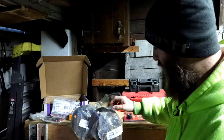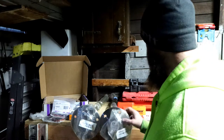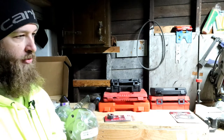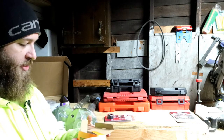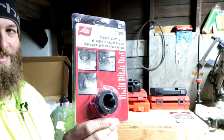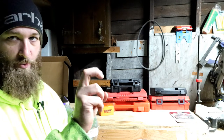Then I got two new axles — both from Yukon, driver side and passenger side. I'll put the part numbers in the description. Next I had to get some new wheel studs. There's no sense in pulling out the old wheel studs from the old axles, so I just got new ones — a kit from Dorman right on Amazon. And if I'm installing them, I'm going to need a wheel stud installer tool. This helps save the axles from getting any gouges or marks on the outer flange, and compared to just using washers, it's supposed to speed things up and is the right way to do it.